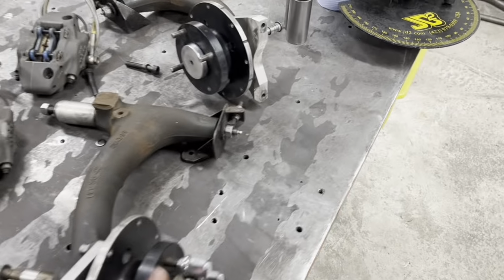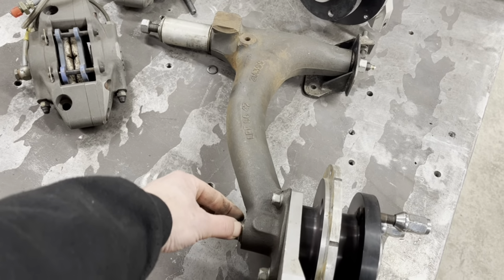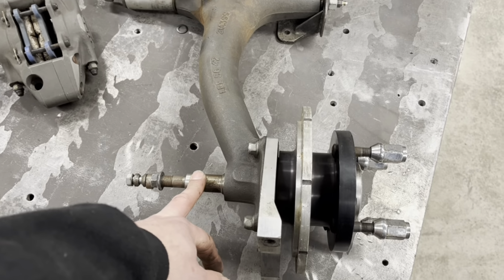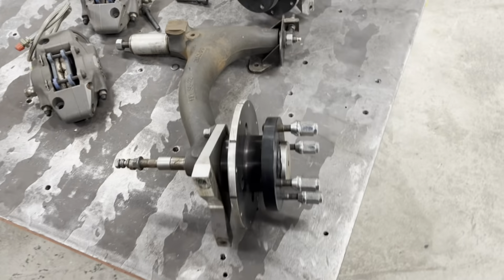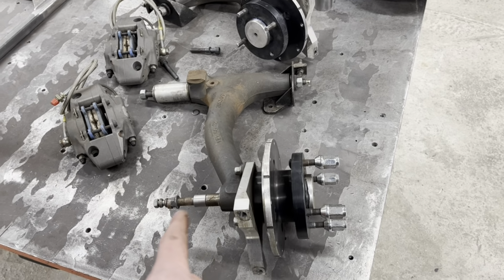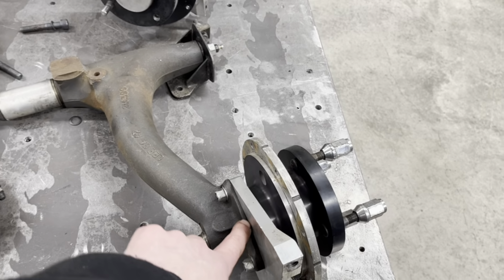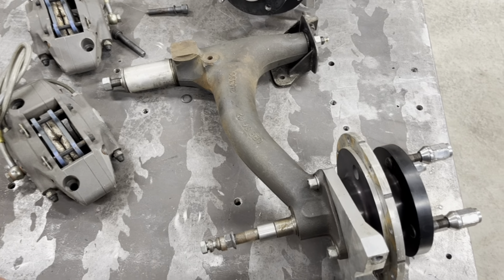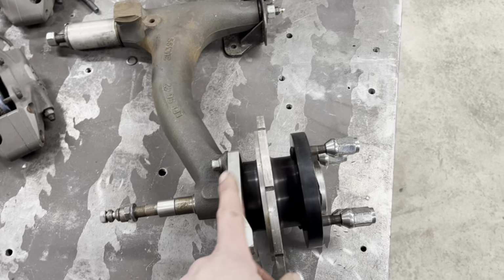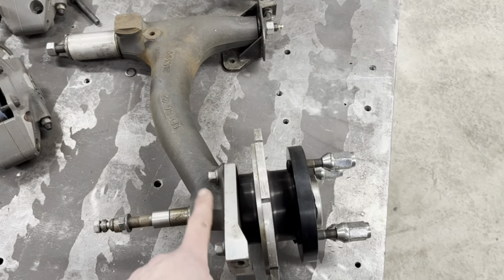So, yeah, we need to get this off and we need to press that out. Now, apparently, I've been asking my mate at CAD and he said some of them do take a bit of pushing or a bit of heat. So, I'm going to strip that off and take this out, because what I need to do is take the measurements off one of these two cars from the center, from this face here across to the other face. Yeah, then I can work out how I'm going to fit this, because I would know the length of my tube needed to make all this work.